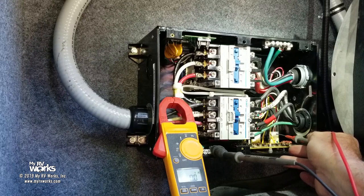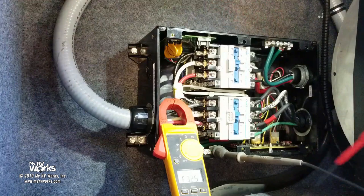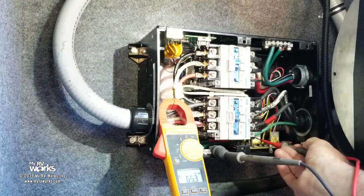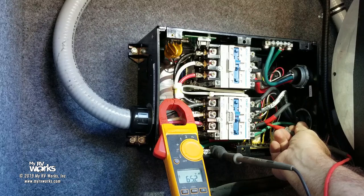All right, the meter just shut itself off. Let me probe right in here. I don't know, like that sound my meter just made, so let me reset it. I get way down here, I'm on A2. A2 only has 65. Plug us back in for a second. A2 only has 65 volts. You want AC power again, right? Yeah, onshore power, because I'm going to compare the two. And A1 only has 65 volts. See that? So that's not 120, and it takes 120 to seal these in.